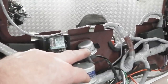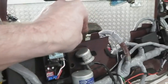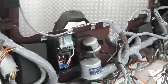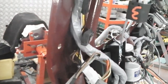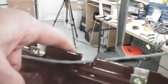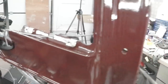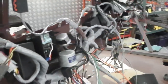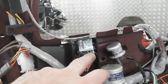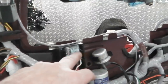But you also need to have the can connected to a sort of resonating plate. In this case, it's the dashboard. If you have it floating, you miss half of the noise effect. So it has to be on that metal clip to get proper sound out of your indicator. That's the reason why the hazard light relay that I've built, I'll talk about it now, is also screwed to this, because these relays, whilst they won't make the same pingy sound as that, they'll still make a clicky sound.